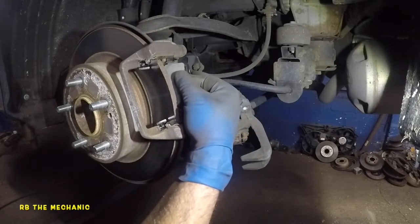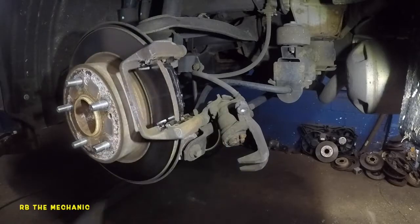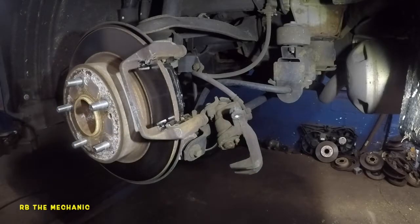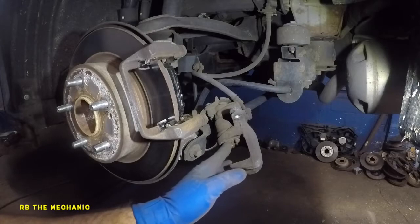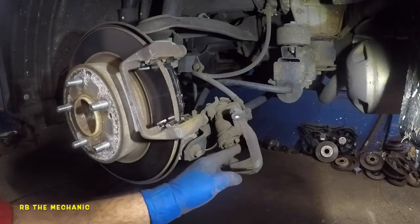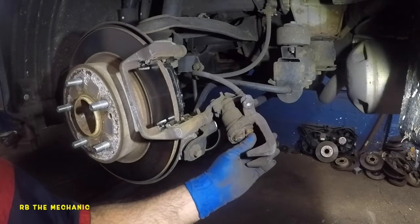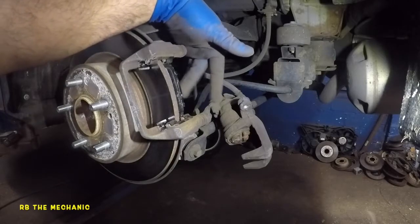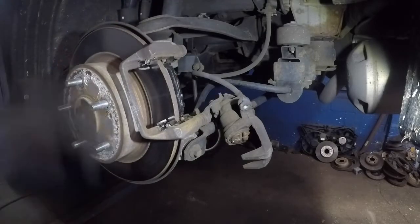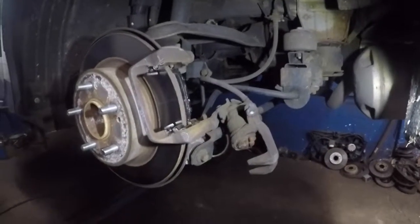This brake pad with the notch needs to go on the inner side. If you look at the outer brake pad, it does not have that little notch. So pretty much, the functions of that little cross in the center are: to compress the caliper, stop it from turning, and to grab onto your brake pad so it needs to be centered. Hopefully this video helped you figure out what that is, how to compress this caliper, and what that little notch in the brake pad really means on this caliper and brake system on these Hondas. Thank you for watching — stay tuned for more videos.